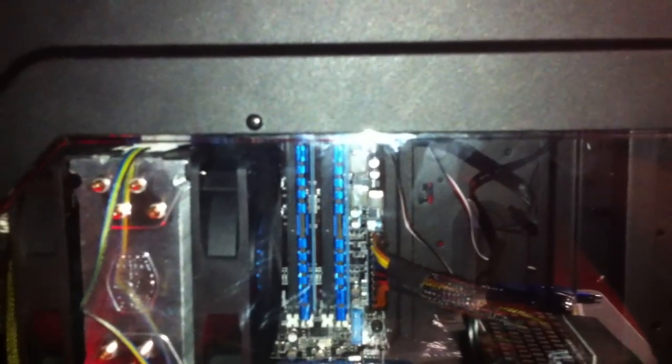The fan is a 120 size called Blade Master. So the fans used for this heatsink is called the Cooler Master Blade Master, and is 120 millimeters in size. So if you wanted to buy a second fan, technically any size 120 fan would fit on this heatsink, but I just wanted to match it up with the same fan that was used from the factory, just because I figured maybe that would give optimal results. But this is made in push-pull configuration, which means 1 fan pushes the air through the heatsink and it is pulled out the other side for better airflow and better performance. So that is the Hyper 212 Plus.